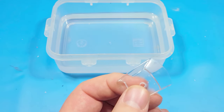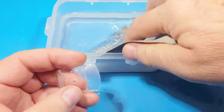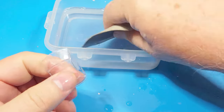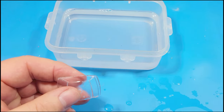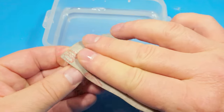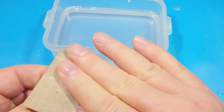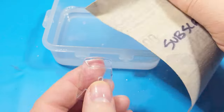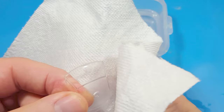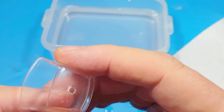The windshield is in good shape but is scratched up quite a bit, so I go in with micro mesh starting at 2400 grit and sand it down. You have to do this layer by layer through all four windows — you have to be thorough on each level because if you miss any grit behind, you'll never catch up again. Other people use paste polishing wax but I find it's not as effective. I go all the way to 12,000 grit and it comes out beautiful, like a brand-new windshield — all the scratches removed.